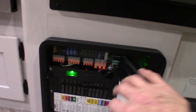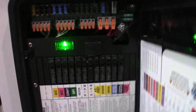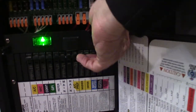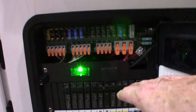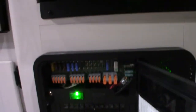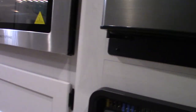This is the power converter. It converts 120 AC to 12-volt DC. You have your regular circuit breakers like you see at home — 120 AC — all labeled, like the distribution center you have at home. Then you have 12-volt fuses here. When you're plugged in it takes 120 AC and converts it to 12-volt DC. It's also a battery tender so it'll sense how much energy your battery needs and keep your battery charged as long as you're plugged in. When you're pulling down the road, your tow vehicle charges the battery.